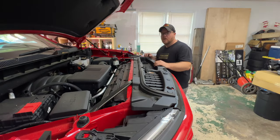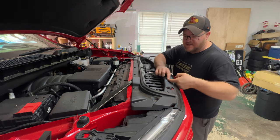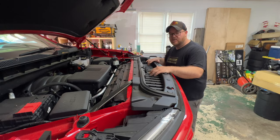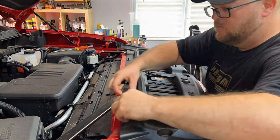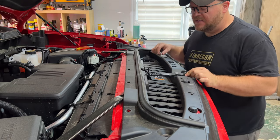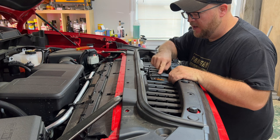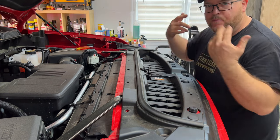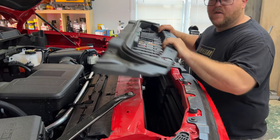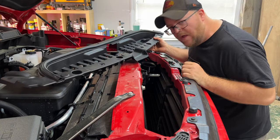Okay, first thing is removing this black trim panel for the air intake. It looks like it's just a bunch of standard little plastic clips — I'll pop those off and get this piece off first to see what we need to do to get the grill out. One thing I found: there are two little torx screws by the hood release latch, so I'm just going to remove the latch and then this piece should pop out pretty simply. With that removed — just a couple torx screws — that piece comes right out.